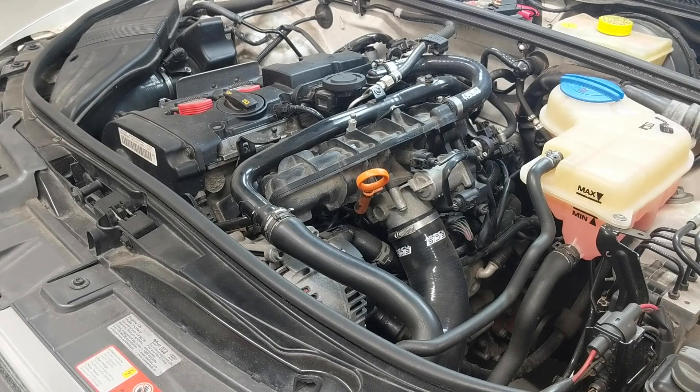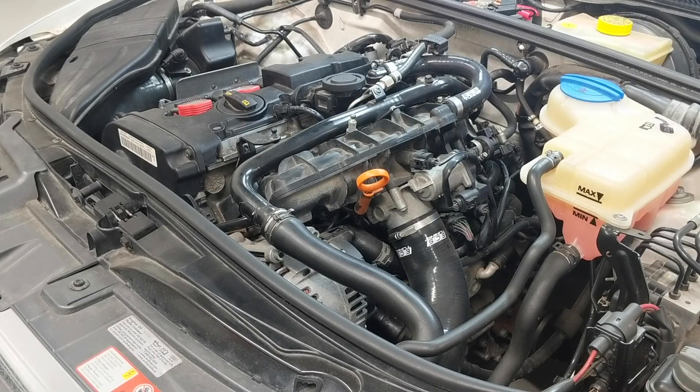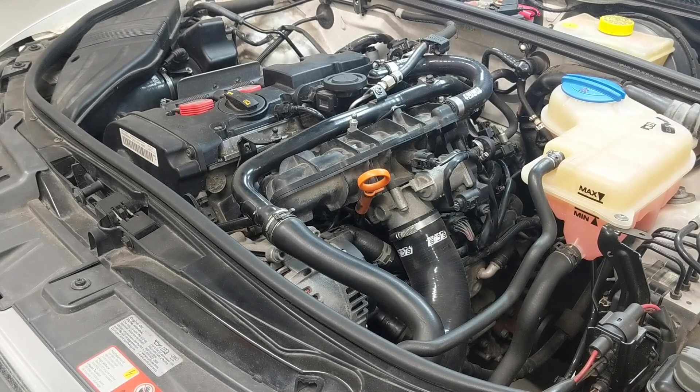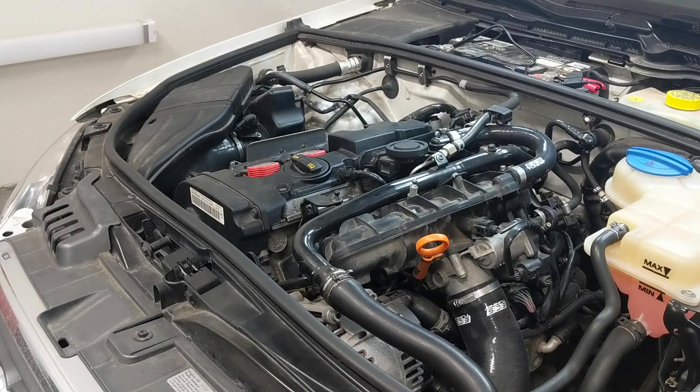Positive refers to built pressures, crankcase is really the sealed long block, and ventilation is the removal of that pressure. I say 'theoretically safe for your car' because the PCV system in combination with direct injection only engines — which is what this is — is basically the formula for carbon buildup on top of the intake valves. Although we might be doing a good job burning off extra hydrocarbons from the blow-by, we're also slowly and ironically reducing the efficiency of the vehicle.